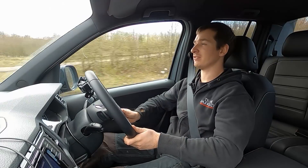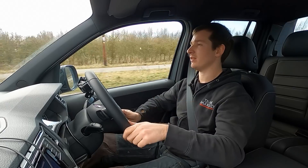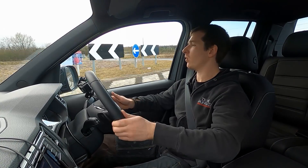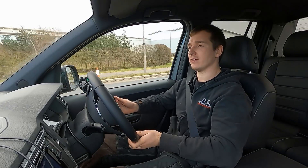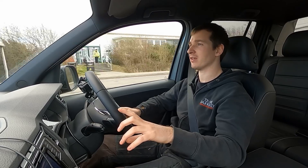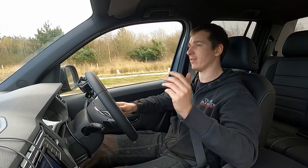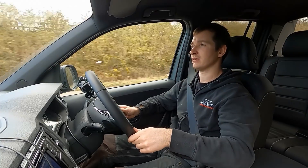We've got 6.1 seconds to 60, which is a fair improvement. We'll put a little table at the end with all the times we've got. The other thing to check is what it'll do with the gearbox tune - I'm not expecting miracles, but we've managed to get it to the proper launch control function, revving up to about 2,500 RPM. I don't think with this turbo we need to lift that up, but when we get the bigger turbos on we'll see.